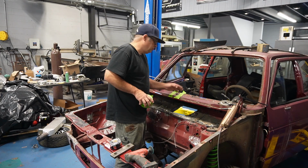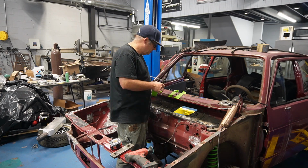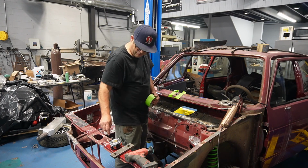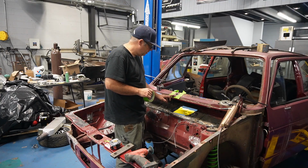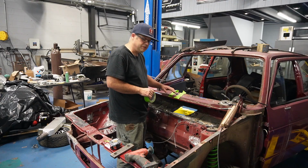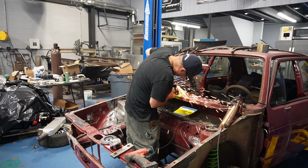That's 2 inches. Just by feel, I'm under a 16. So the other thing you're gonna want to stay away from is this edge. You gotta kind of split the difference, because if you go down to here, it's gonna make it warp. If you can leave this bend, it's gonna make your piece straighter. All right.